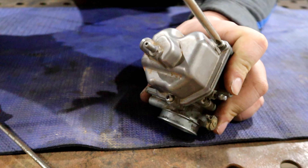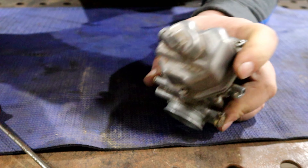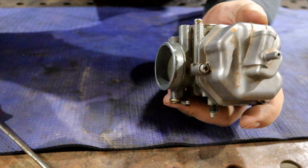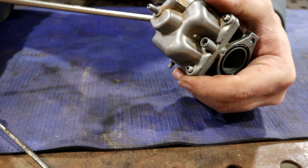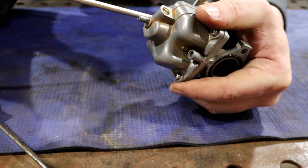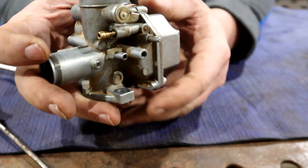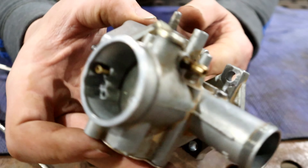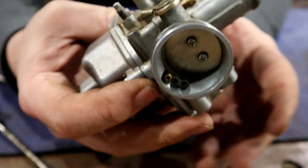Alright, so that's it — we're literally all back together now. Do not over-torque this thing. It's just good and tights all the way around. It's all O-rings, shouldn't leak. It does not need to be hammered home. If you look it up, I'm sure it's just a couple of inch pounds — you don't want to strip these screws. All back together, looking like a good carb. We'll put her on — hopefully it runs.